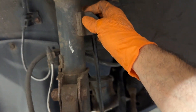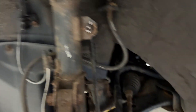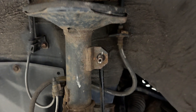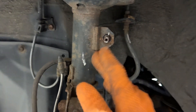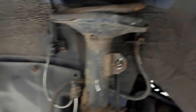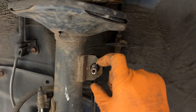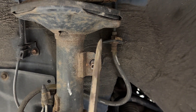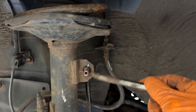On a car from Florida or California that's never been exposed to road salt, you could put a 5mm Allen in the end of the stud and take the bolt off easily. But most times, sadly, if you're anywhere north of the Mason-Dixon line, you have to cut these off. What I like to do is take my cutoff tool and go straight in from the front, slice the stud and nut in half, then get in there with a chisel, hit it with a hammer, tap the nut closed, and it should just fall off.